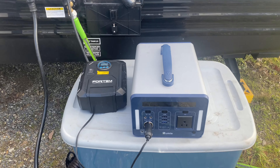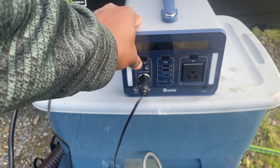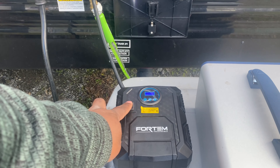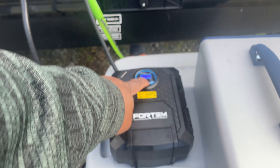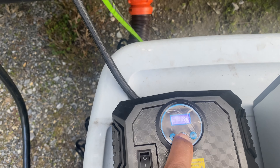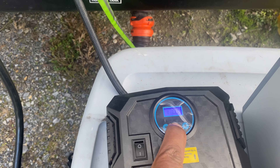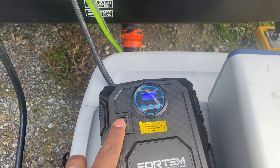This next process we're going to blow air through all the lines, cutting on each faucet one at a time. Remember, if you have an outdoor shower you have to do that one too. Also, if you're going to use an air compressor, make sure you have a way to power it — we're going to use a 1,000 watt portable power station, a Romia 1,000 watt unit at 99%. We're going to set the compressor to 15 PSI. You don't want to blow the lines out in your RV, so 15 PSI should be enough air without damaging anything.